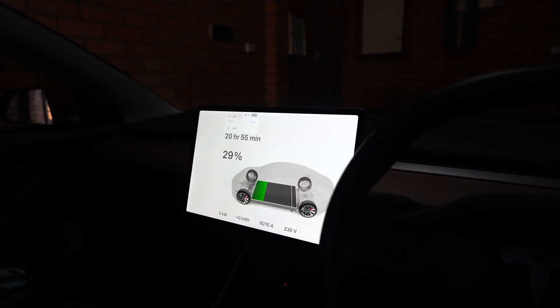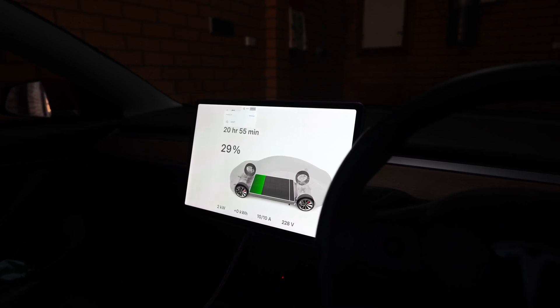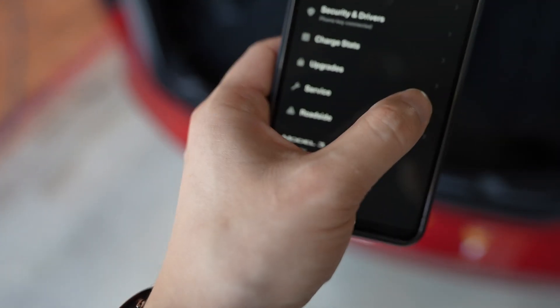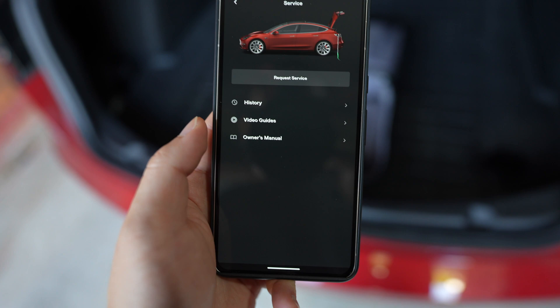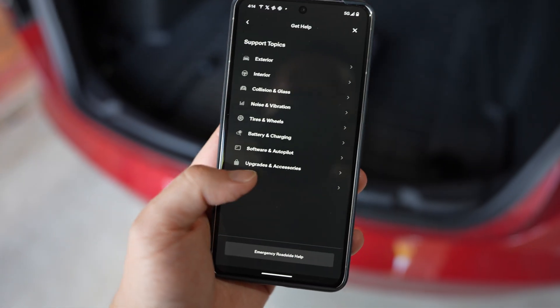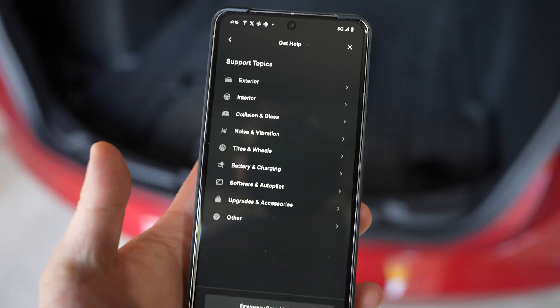We saved about three hours just from 2 amps — that's pretty good. For me this is my main form of charging, so any extra amperage is greatly appreciated. If you're interested in getting these tails yourself, you have to go to the Service section in your Tesla app, request service, go to Upgrades and Accessories, and then tell them you want the 10 amp and the 15 amp tail — that's what I did.